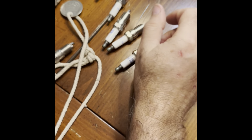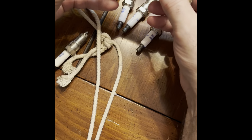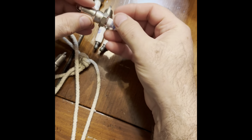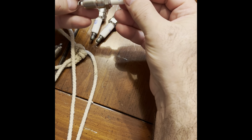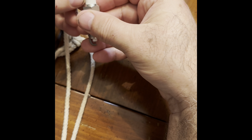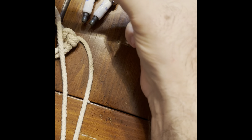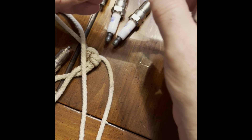After about a week, I finally got my spark plugs in for my '06 Chevy Silverado — the first-gen 2006, 5.3 liter V8, last of the Vortec. These are not the original part numbers that were in the truck, but it's been superseded now with the 41-110. These are iridium — the original iridium in the truck — and I've replaced them with the AC Delco Professional.